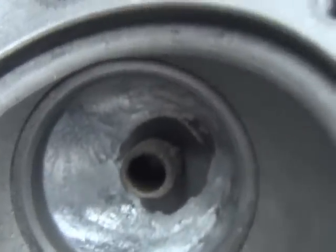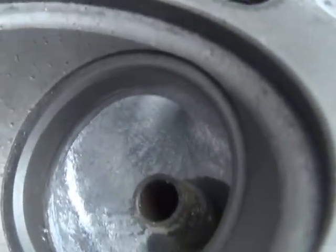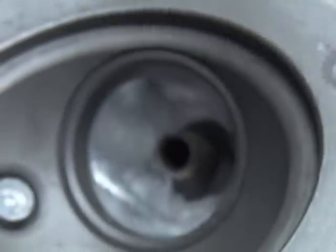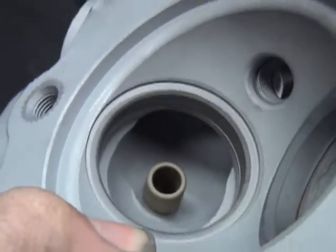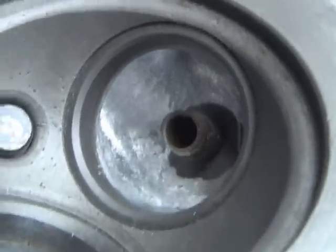So the intake — you can see what we did on the intake, how that's been cut out quite a bit there. It's real tricky to get all these edges out of here. You can get an idea of the difference between this one and this one — you can see the huge difference in size, especially going through this throat right there. You can see how much bigger that one is going through, radiused all out.